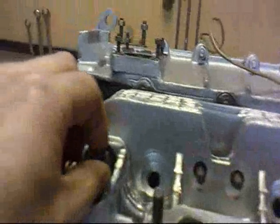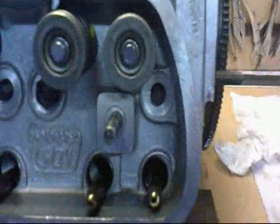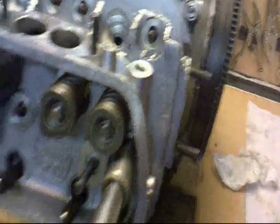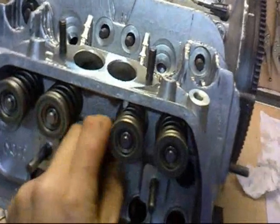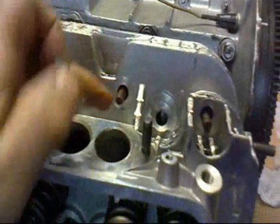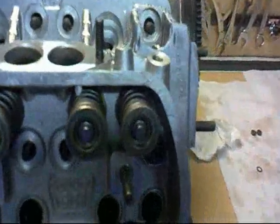Put one in the top left-hand corner and just run the nut on. Same thing in the bottom right-hand corner. And the two outer ones, you just nip up a bit, not a lot, just enough. And then you can take off the one that you put on with no washer. The reason you did all this is to have enough studs sticking out to put the rest of the washers and nuts on. You also check once again that everything's looking nice down here. Okay.